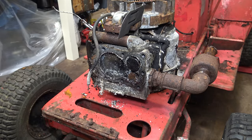This is the part number of the new kit, 294628, and included in that kit is everything you need, including this little spring compressor, so you can remove the wires from the existing condenser and of course refit them to the new one. So it just fits over the top, you can then push down and it will release the wires. Yeah, it's very corroded. Dispose of these because you get all this in the new kit.